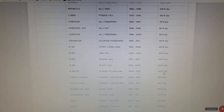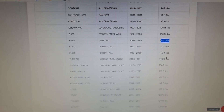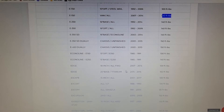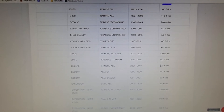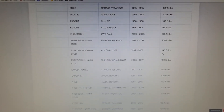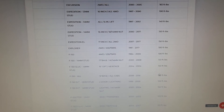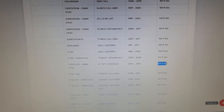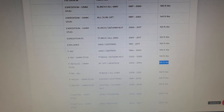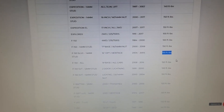Now I will show you on my computer — every vehicle will have differently specified torque values. You can see Ford Edge at 100; 18-inch but 20-inch wheels at 150. Escape 2001 to 2017 is at 100. Expedition at 140, F-150 at 150. Older F-150 like 100, but newer ones will have 150 or whatever. So that's what they mean — this is here for a reason. If you follow this, it's going to extend the life of your brakes, your wheels, your wheel hubs, your studs, and you'll have a nicer and smoother ride.